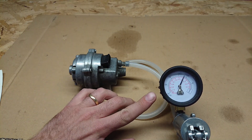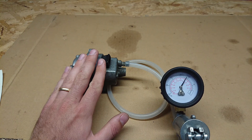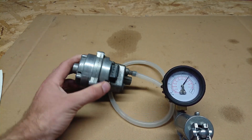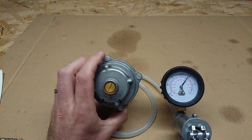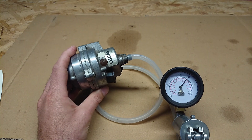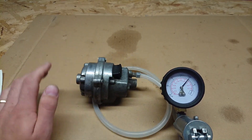This is the test that no one actually does when they try to sell you a used one of these on eBay or anywhere else. They'll test the connections, see that it's electrically fine, confirm no one has opened the rivets or tampered with it, and sell it to you as a good unit. But it's not going to run right. That's how to properly test your MAP sensor at home — you need a vacuum tester to test it fully. Just testing the electrical part is not enough.